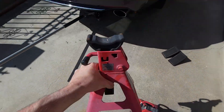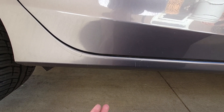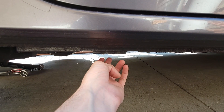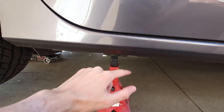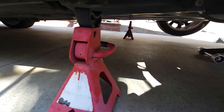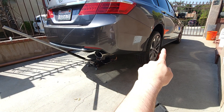Now that the wheels are off the ground, I'm going to get one of the jack stands. Be sure to refer to your owner's manual if you don't know where the jack points are — almost every owner's manual will show you exactly where they are, sometimes with arrows. On this vehicle we can see a reinforced piece right here, and that's where we want to rest the jack stand. We'll do the same on the other side. This one doesn't slide under yet, so I need to raise the vehicle a bit more. Now it's slid under. Next, slowly turn counterclockwise to relieve pressure from the floor jack so the weight rests on the jack stands.